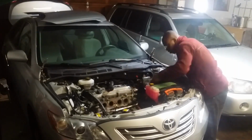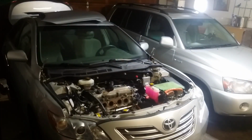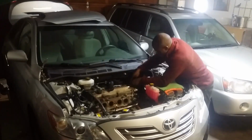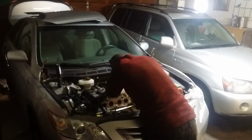With that being said, heavier oil may be a great solution on, say, older engines, but in modern applications, with many of them having multiple solenoids, timing chains, and cam adjusters, it would be wise to just trust the engineers and use the correct oil to ensure everything operates like it's designed to.